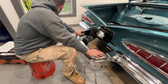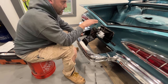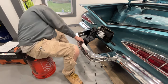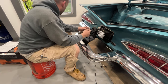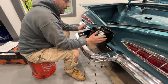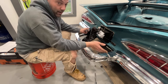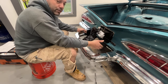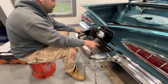There's an emblem that goes on the back side of the cover that needs to get installed. The bracket for the license plate needs to be installed, and the kit comes with a little light which goes on the back to illuminate your license plate. I spent about a half a day getting this all lined up, drilling holes, tightening it up, getting it to line as best I can right to left. I haven't done the rear valances yet — there's still a lower valance that needs to go on, backup lights that need to go into the rear valance, and the center section of the rear valance needs to be cut to accommodate these brackets that the continental kit comes with.